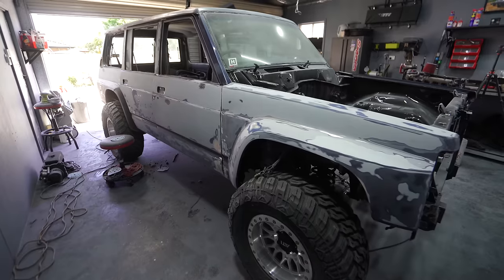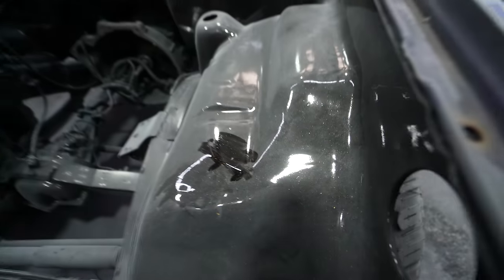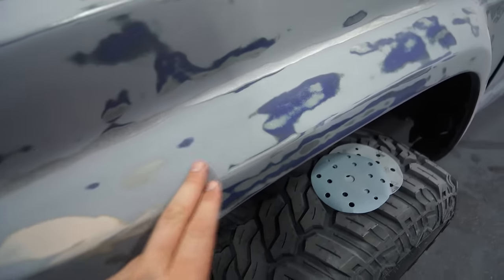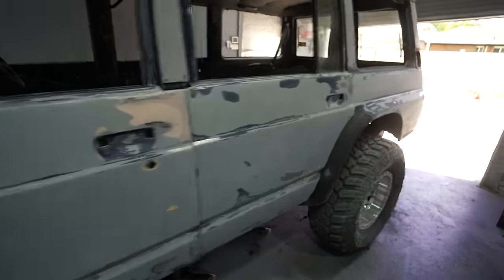I'll give you guys a quick run through of where we're sitting. The engine bay is pretty much done — I did this shaved engine bay, it's a little dusty but it's done so we don't need to touch that at all. The outside of the car is what we're painting. We've got it down to basically the primer and the original paint. If we left the acrylic on and sprayed new paint over the top, there was a good chance the chemicals would react and cause fish eyes and fuzzy bits. So we decided to completely remove it down to something more stable — the primer — and it's sanding really nice.